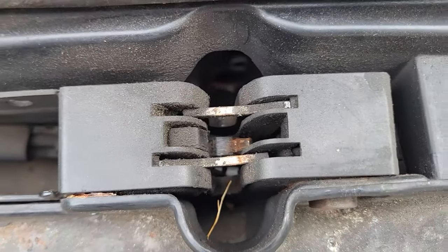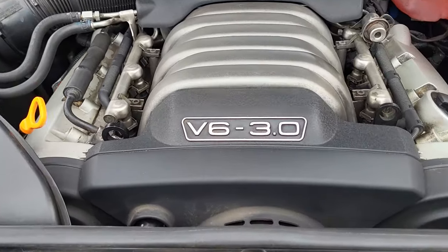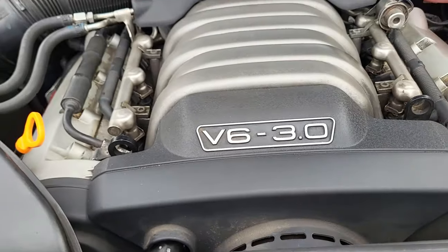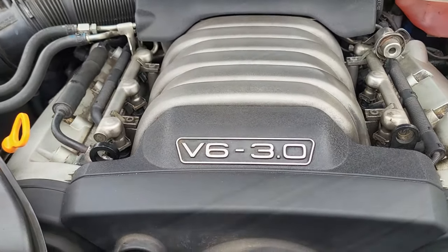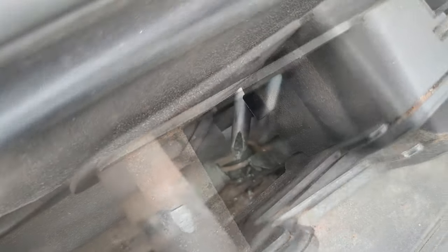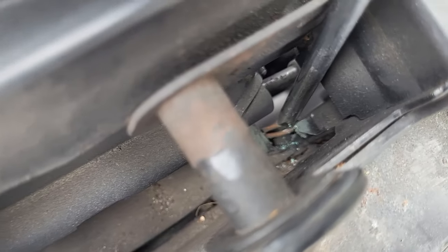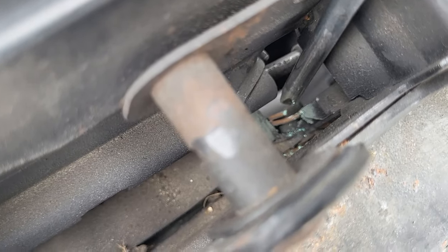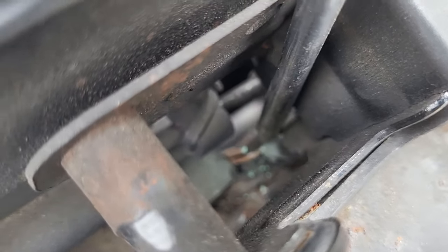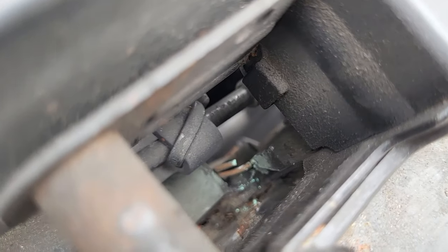Mine's got a little bit of copper showing on it — that might be the problem. If the car doesn't see the bonnet open, it doesn't know to reset the oil level light. It seems a crazy system, but without knowing to reset, the oil light will never go away. I think I've discovered the issue — just pushing that brown lead with a screwdriver, it's snapped off just in there. It's snapped clean off of this micro switch, and that micro switch is what tells the car that the bonnet is open or closed.